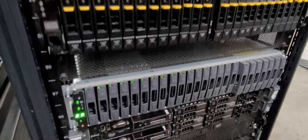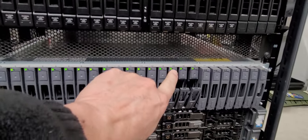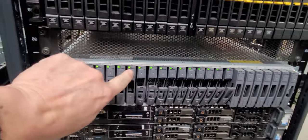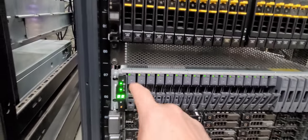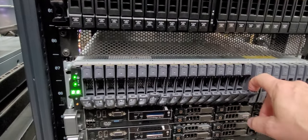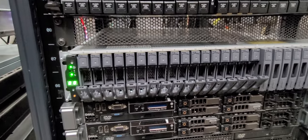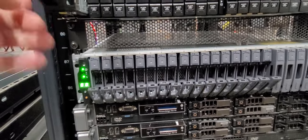So as you look down here, I have popped the SAS controller interface out. Sorry for the terrible movement. But now I'm going to deinitiate the drives from the bus. By doing that, I'm going to clear the SAS controller's configuration of detectable devices. It matters, trust me. So I'm going to go ahead and start deinitiating them. They're going off the bus now. The controller will eventually report zero value on the bus, which means that the next time the SAS controller is posted, it will be zeroed out and clean and ready to go. So you'll have no inherited headaches coming from some other source.